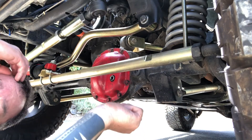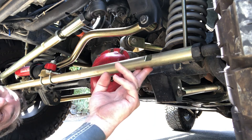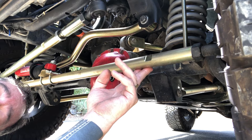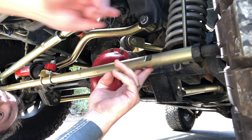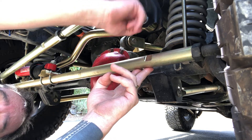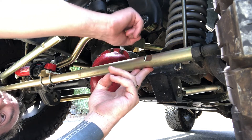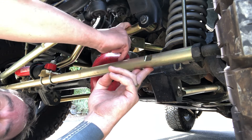I just put the track bar in. There's a lot of videos that show you how to put in a track bar, so I didn't want to beat a dead horse. These are 21-millimeter bolts, just so you know. Torque these down tight — you don't want to play around with this track bar. You're going to feel it in the front end. This thing's vital, the track bar.